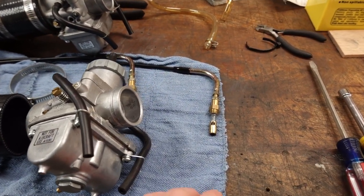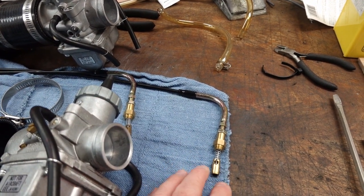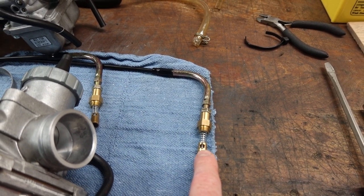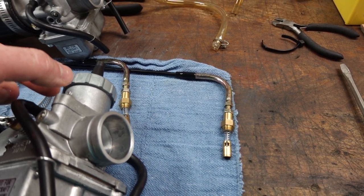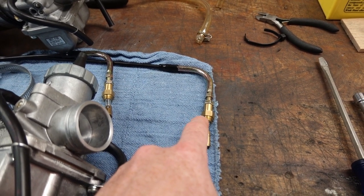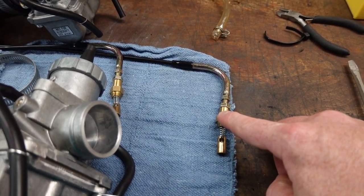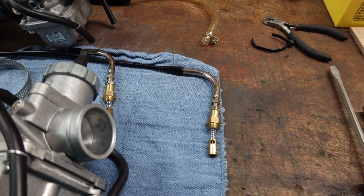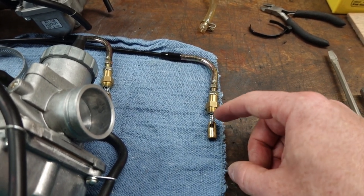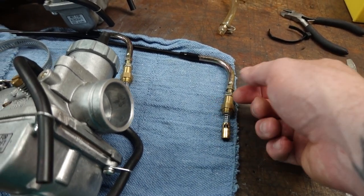And then here are the plungers on this snowmobile choke cable. These are the plungers you'd use regardless of whether you've got just the little plunger cap or you're using the lever type. And what you need is these choke cable adapters. You need these to be able to use some kind of choke cable with these carburetors. Otherwise, there's nothing for this cable to run through and compress this spring against. And these are Mikuni parts.